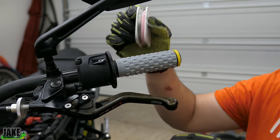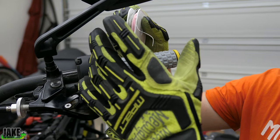Safety wire — you're going to want gloves because safety wire is dangerous. I'll do three: one here, one in the middle, and one on the end. Snip it and hold your finger on it because it can shoot off like a toenail. I've never had the fancy safety wire tools — I just grab a pair of needle-nose vice grips, clamp them down, and twist. On the clutch side you can make them pretty tight. I like to trim them leaving about two or three threads still on there so they don't come undone. Use a screwdriver to bend the tip up and mash it into the grip. When you're done, run your bare finger over them to make sure they don't make you bleed.